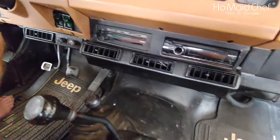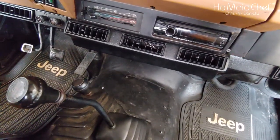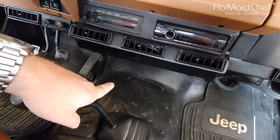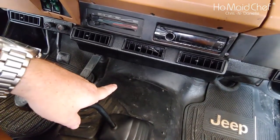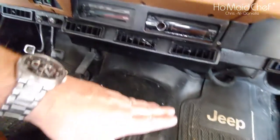We do have to do a little bit more insulation on the floor in this Jeep because in the 90-degree Florida weather, the boom mat is not providing adequate shielding. It does help deaden the noise, but with the catalytic converter under the floor here, it gets a little warm.